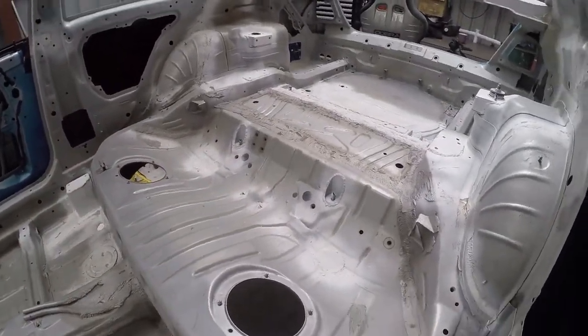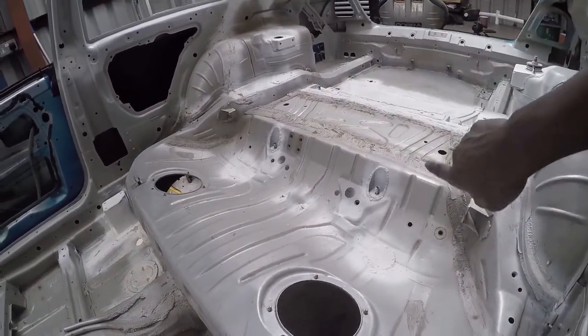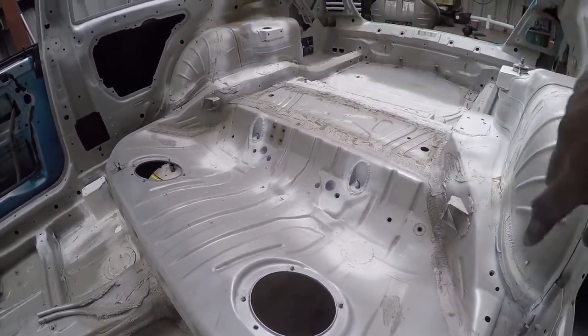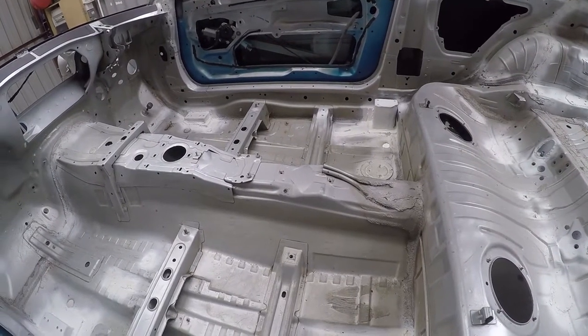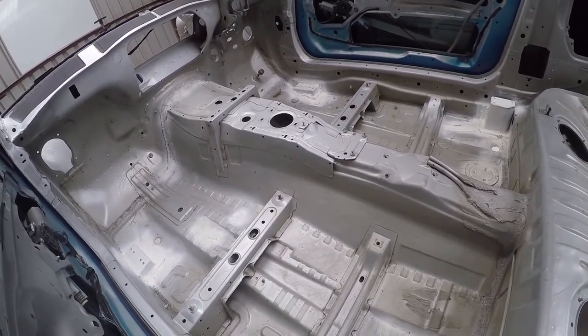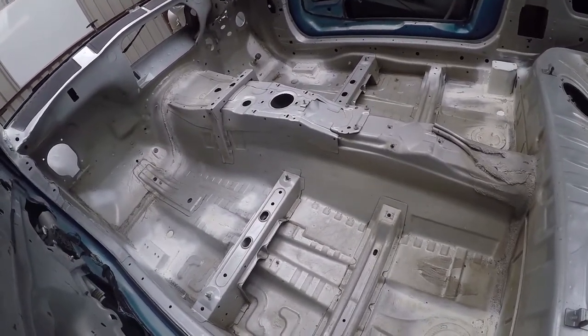Similar deal with the front subframe mounts — I've just cut away these little inserts and welded in some steel tube and profiled it, and then I've got a bar which comes across and picks up from these two points here. Another view of the feet for the roll cage that I've welded in and primed. Same deal with the engine bay — going to use some white POR15 and brush it on, so we'll see how that turns out.